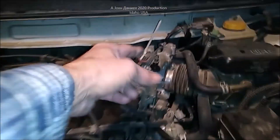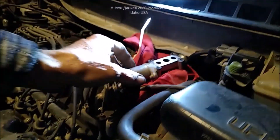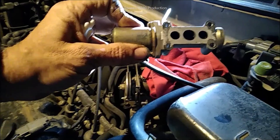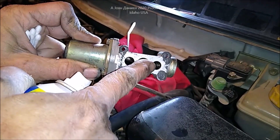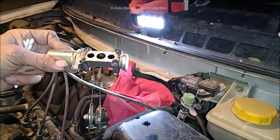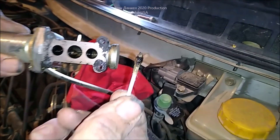If you have to, you can cut the wires and use butt connectors to put them back together — same wire, same color code. Now with it out and a rag over the top, you're going to look down in there. You can see how nasty that is inside — pretty gummed up, a lot of carbon on that valve side. What I'm using here is direct injection intake port cleaner, and it works really good. Usually the cause of all this is ethanol in the gas.